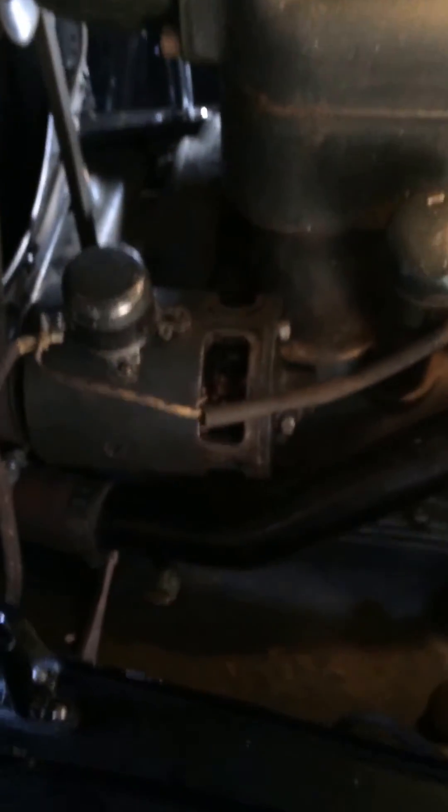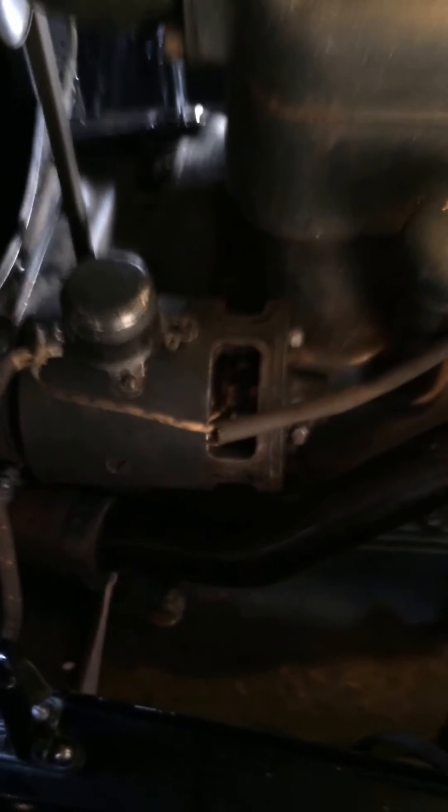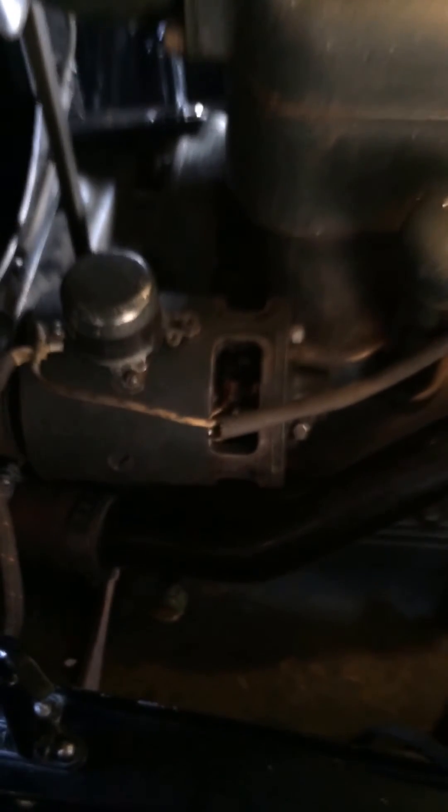Still all the original generator and diode cutout. That third brush needed to be adjusted downward — it was sitting too tight, so I had to take the whole thing apart, loosen it up a little bit, push it down, then go back, put that end cover on, and I think we're good.